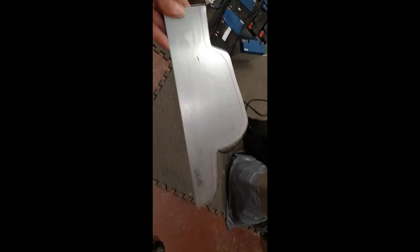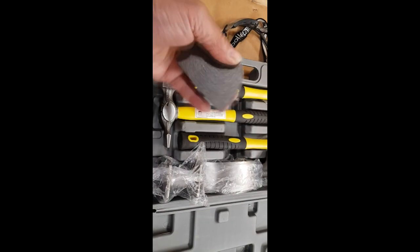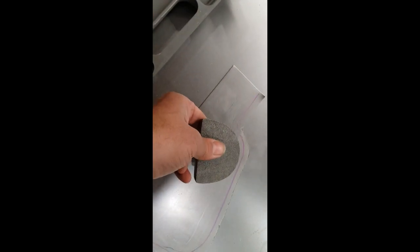There's my template cut out — I think it's 1mm steel. I found some 1.2mm which is quite good. I've cut around with approximately a 10mm lip in places, so that's going to go inside the car that way. I'm going to bend the lip inwards and follow it round. On the straight bits I can clamp it in the vice, and I've got this cheap set of panel beating tools — maybe I can clamp this behind certain parts that need a radius and just tap them around onto that edge.